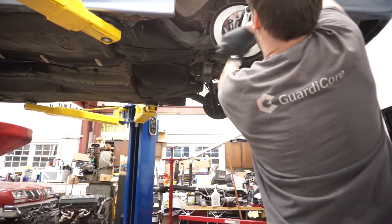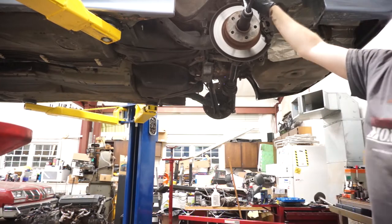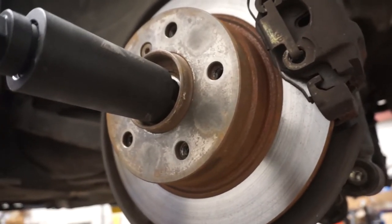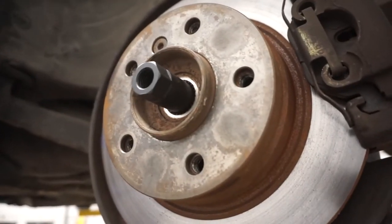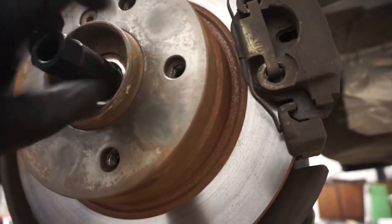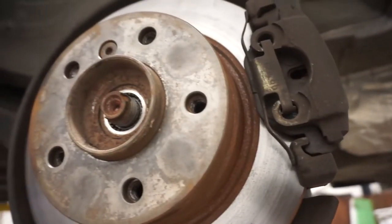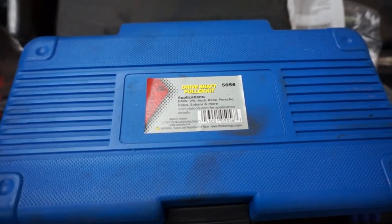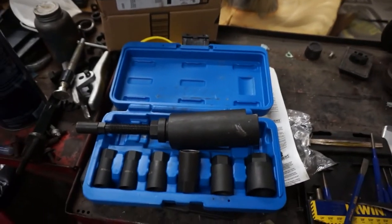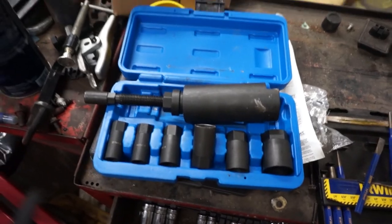If we come to the other side, you can see it pulling through as I pull it. It just stopped — I felt a hard stop. We're going to back this off and take this assembly off. You can see the thin wall socket is much further through. We take the thin wall socket off, and voila — you have an axle that came through with no damage. That is CTA Tools 5056, and I'll include a link in the description. I highly recommend this. We've destroyed a number of axles trying to do it the wrong way with makeshift parts — this makes the job a complete cakewalk. Trust me, you want this tool set.